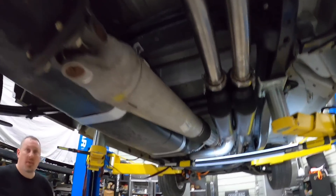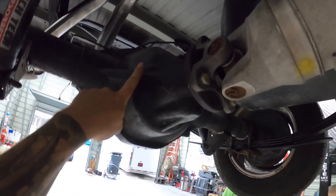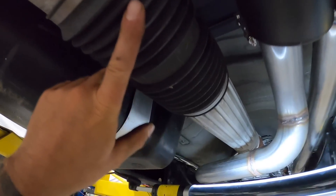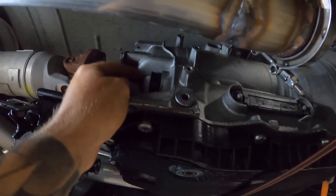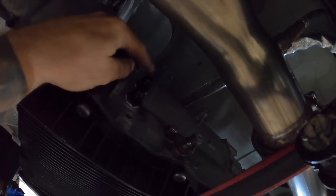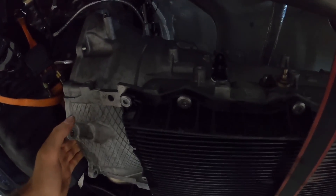It ended up working — we converted it to this style and put the flange back on. The backlash definitely needs to be adjusted, and we're going to take out the 3.55 gear set and put the 3.92 from that axle afterwards. She's bolted up — we've got our slip all the way forward, we've got our 8-speed in here, and this just worked out too nice. Right now we've got a full drivetrain. We need to run our connector into the cab and get all that wiring going, and we'll also have to loop this dash-8 for our cooler and put in our torque converter bolts.